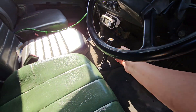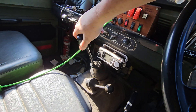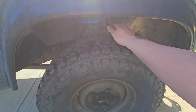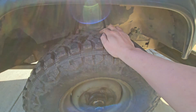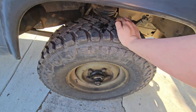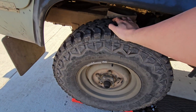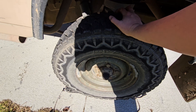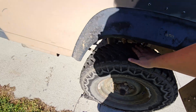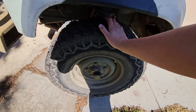Now that we're not at risk of rolling away, I take the handbrake off and put it into neutral. If you've got your car up like this, it's a good opportunity to give your wheels a wriggle and check that the wheel bearings are okay — also check for embedded stones. That front wheel is a bit clunky; that one's probably due to get done. I have a spare set. This one's not too bad — could be just the kingpin.